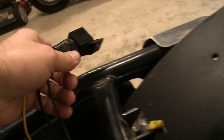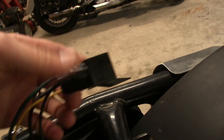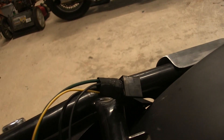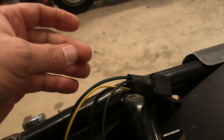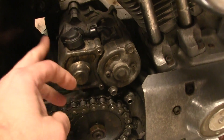It turns out to not be the starter relay, because after my buddy Carson came over last night chasing wires and putting multimeters on things: power's going to the relay, power's coming from the switch to the relay, here's the wire that goes to my starter - and there's no power coming out when I hit the starter switch. But after taking the wire off the starter and hitting the starter switch, then there's power going through it. So apparently in my solenoid, something is a mess - something must have gave out in here. I guess the saga is not done with the redemption bike.